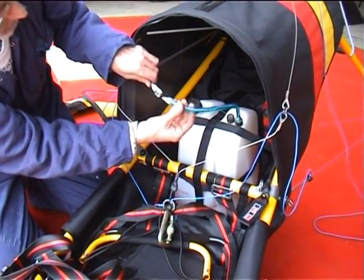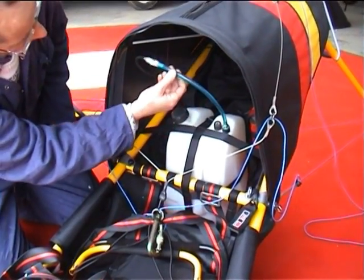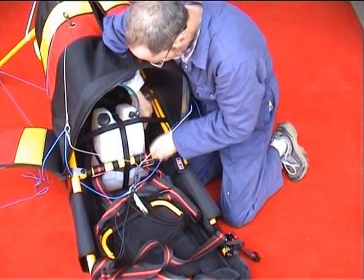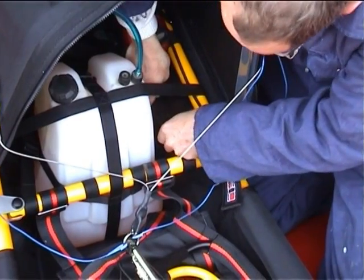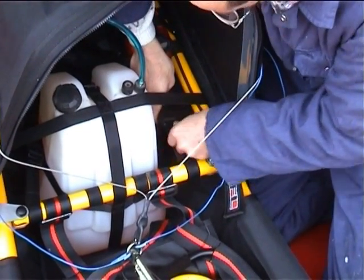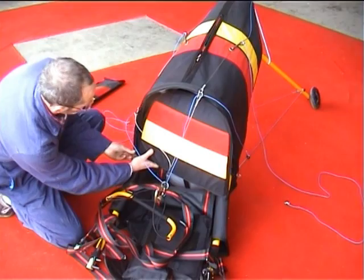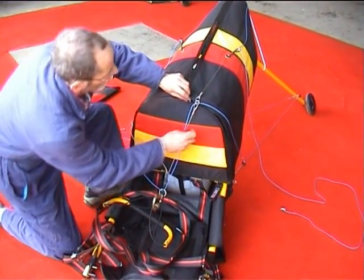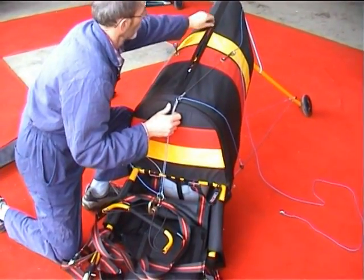Find the 3mm fuel line from the engine and connect it to the fuel tank. If the doodlebug is fitted with an internal bivvy bag, make sure the front of the bag is connected to the seat back tube. Swing the door of the top fairing around and zip it in place, then zip the top of the fairing closed.